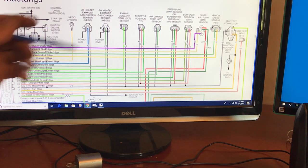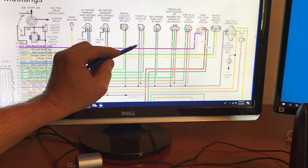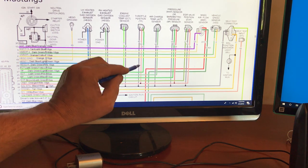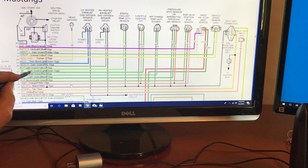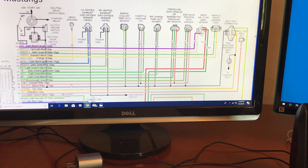To start out with, it's going to be a black wire — pins 46, 26, and 47. Follow the green over here: pin 47, light green, 18 gauge. Your 60-pin connector right here — you can print this out. You're going to start at the top row or bottom depending on how you have it. I usually mark it with 60 at one end and 20 at the other so you know where your pins are.